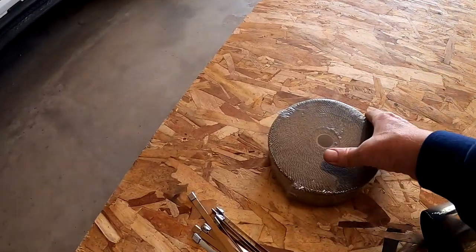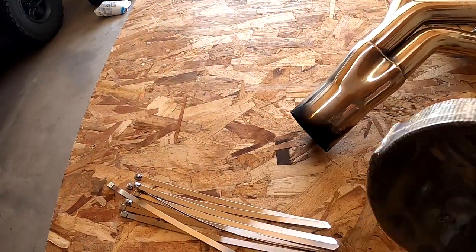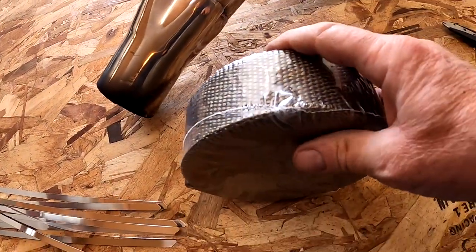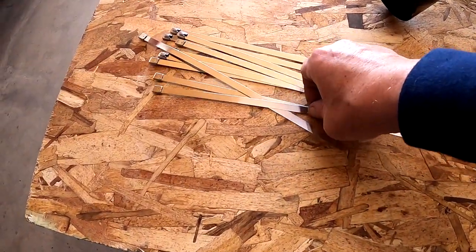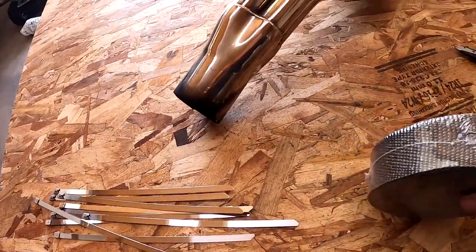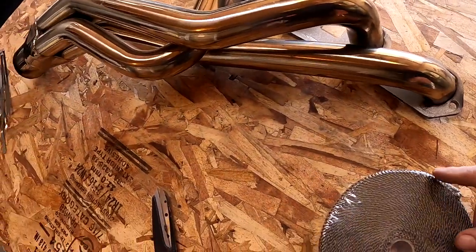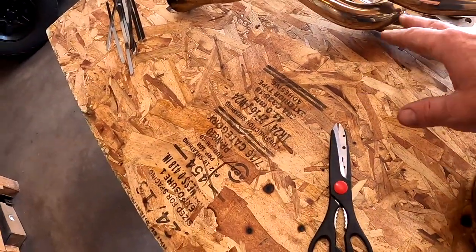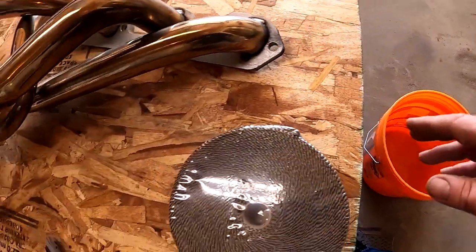So this is the exhaust heat wrap. I'll put the Amazon link in the description on the stuff that I like using. And that's about a 2-inch wide tape. And then here are the straps that come with it to hold the end so it doesn't unravel. But what I like doing is starting at the top of the pipe and cutting a length of this, estimate what you need, and then you need to soak it in a bucket of water, get it wet, and then start wrapping.